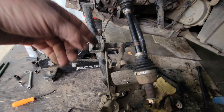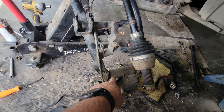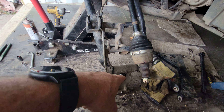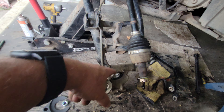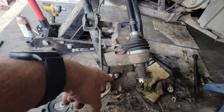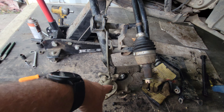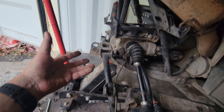I don't know if this widened out or if these shrunk, but I was looking online — brand new knuckles will cost me $115 a piece. Next time I go to service these things, they're getting brand new spindles or knuckles, hands down. I'm not dealing with this anymore. I don't know if something on this thing is twisted, but that's why I keep wearing out bushings.